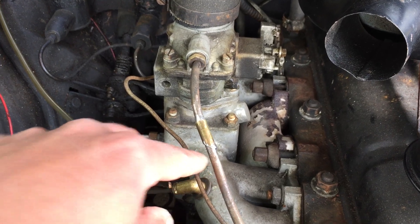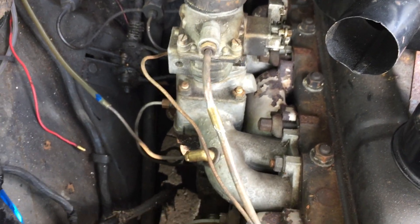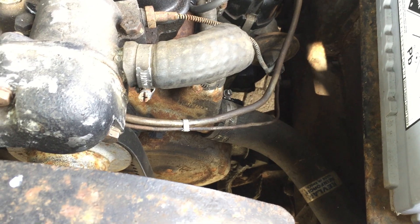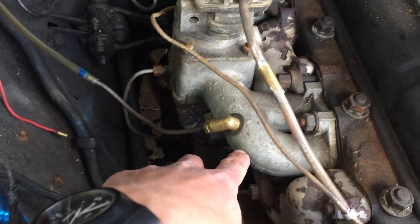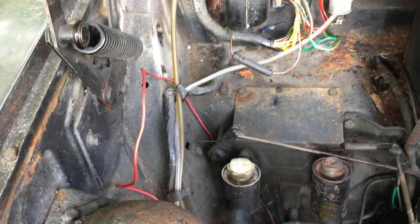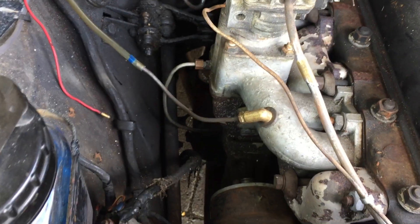It was quite awkward to solve and it has been leaking again, so I'm on the lookout for a replacement pipe. I'd like to put it back to its original routing — as far as I can see from illustrations, it comes up from the pump, supports the thin vacuum pipe for the vac advance, cooled by the fan, and up to the carburettor. I've got this takeoff here, used an old oil pipe for this part, then onto the tubing to go inside to the vacuum gauge. I've now got a copper washer for that, which I will utilise.